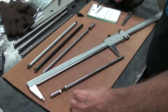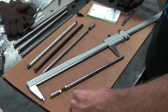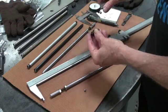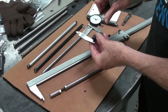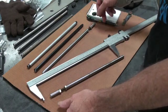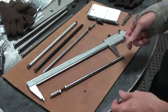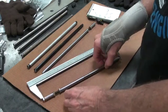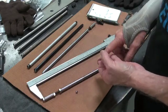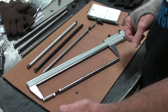So you'll want to tell them your net length, cup and ball, 5/16, 5/16. If you need some adjusters, these work good with stock rocker arms or stage 5s, and they're 1.25 long. If you don't specify 1.25 long, and there's times I haven't, they send you longer ones, and guess what? They will hit your valve cover, and you'll be unhappy. So get that information together. Smith Brothers, Manton, Trend, several people make push rods, and get your stuff on order.